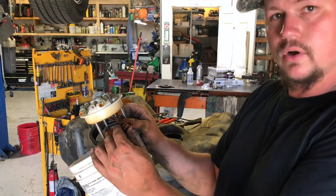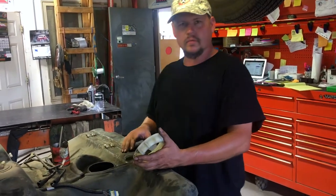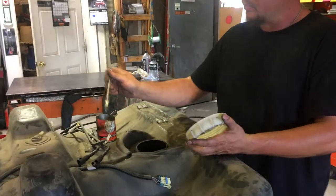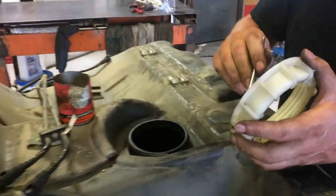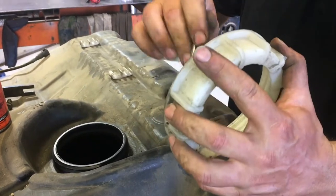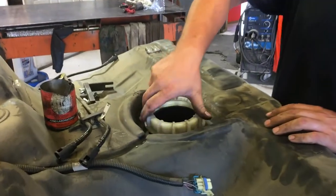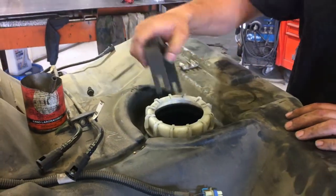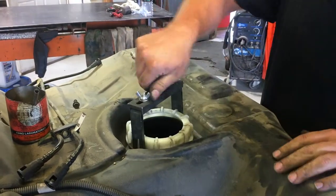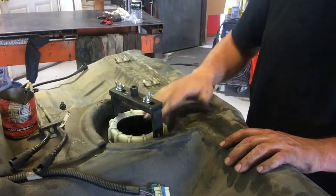What we're going to do is go ahead and put a whole brand new sending unit in. We're going to sum up this video because we don't have the fuel module yet. What I like to do with these rings before I put them back on is put a little bit of grease — this right here is Vaseline or mineral oil. I just brush it in here, and what this does is it makes it very easy to screw this back on, so when you're using the tool everything goes on really nice and you can tighten it down without any resistance because you've greased the ring.